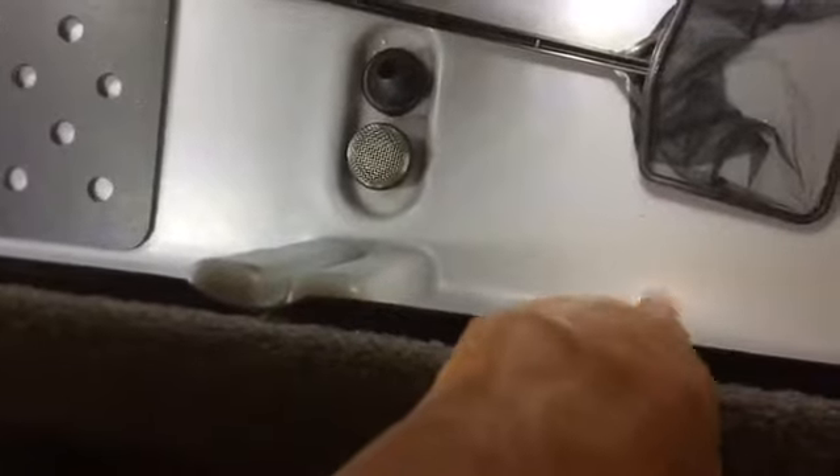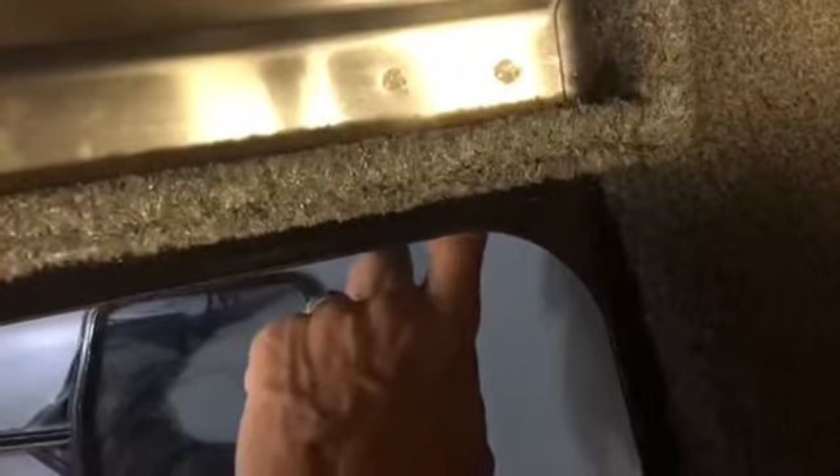So that's that one. Now for the live well — you're gonna have one light starting here and let the wire run this way and around. There's one here, one right there, and then the fourth one on the light string is right there. Now I have the wire and excess wire coming up to this back corner. What I did was at the very top of the live well I drilled a very tiny hole — just big enough to get that wire to pass through. You can see that right there — that's the wire, that's the hole at the very top of the live well that I passed the wire through.